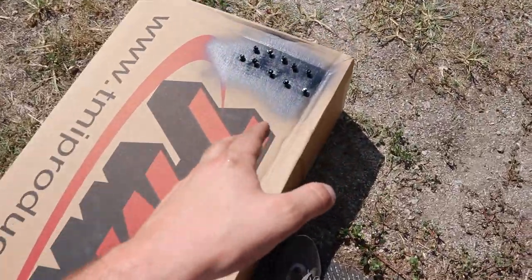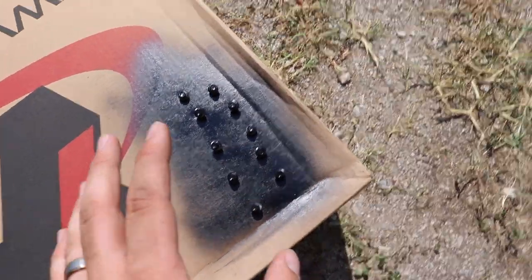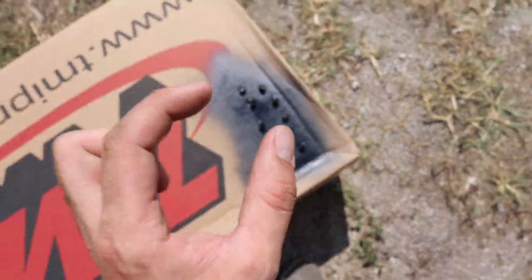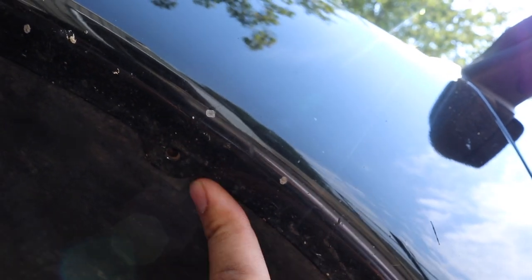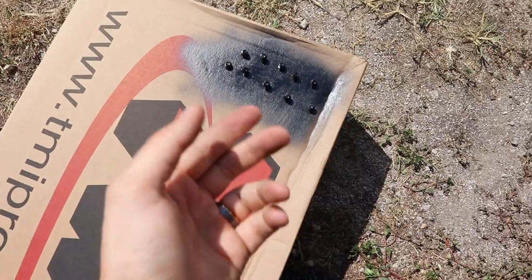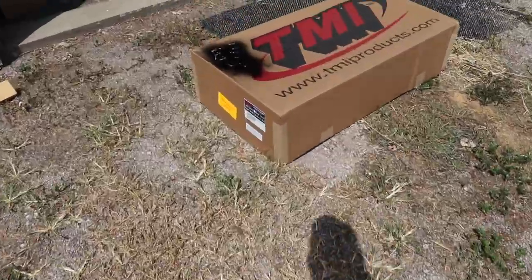We got the liner set in place, however I'm waiting on my screws to dry. There was no hardware that came with the liners, so I just took all these small self-tappers. I don't actually have to self-tap into any of the truck's paneling — there are already little metal tabs that you thread into. You just go through the hole that's already in the paneling, and there are little metal tabs clipped onto this plastic fender that it threads into. I just painted them black so they match the truck instead of staying gray. These should be plenty dry — let's get those liners tacked up.